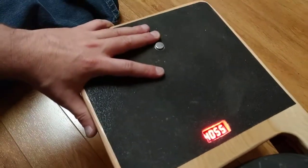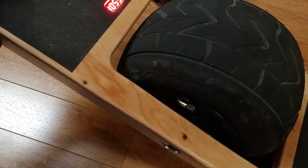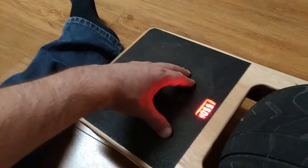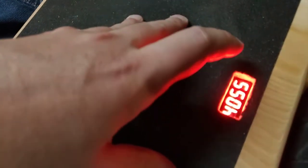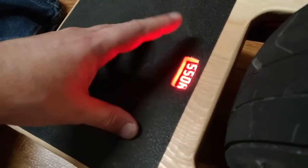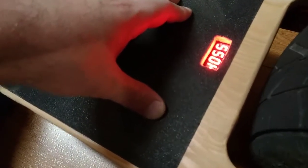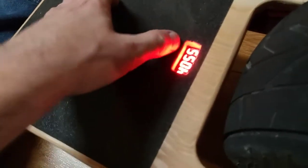The next option is your multiplier — your power multiplier. This board's throttle is determined from 100% forward to 100% backward. It takes the current tilt: let's say 10 degrees, multiplied by this value. The display doesn't show decimals, so a displayed value of 55 is actually 5.5. So it takes 10 times 5.5 and gives you a forward throttle of 55%. If you're only at 5 degrees, it's going to give you 27.5%. That is your throttle multiplier.